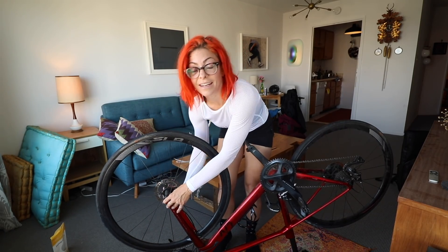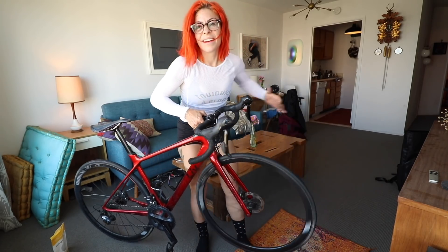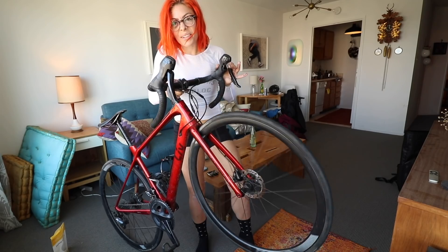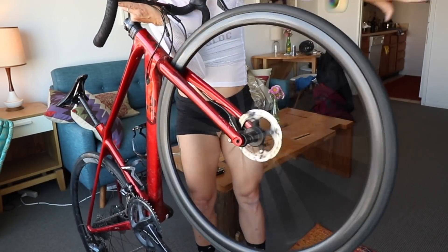Is it possible to open your rotors too much? That's the next question, because I definitely feel it's a lot easier to put my wheel back on. There's a little rubbing going on — just a slight amount — so maybe I could have opened them even more. That's how you fix your rotors with a butter knife, guys. I'm going to wash my hands before I touch anything. Thanks for watching — subscribe, like, share with a friend, and hit the notification bell. The wheel moves — woohoo, did it! That's how you fix your hydraulic disc brakes with a butter knife. See you next time.